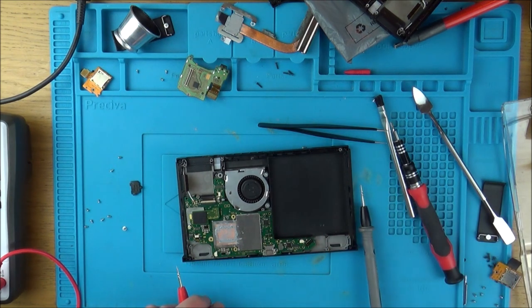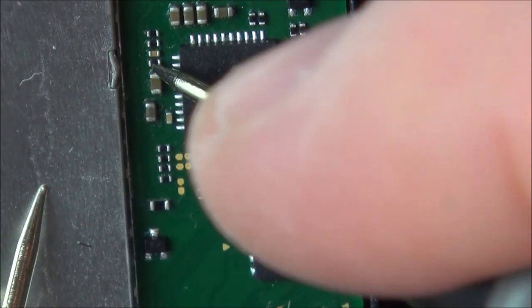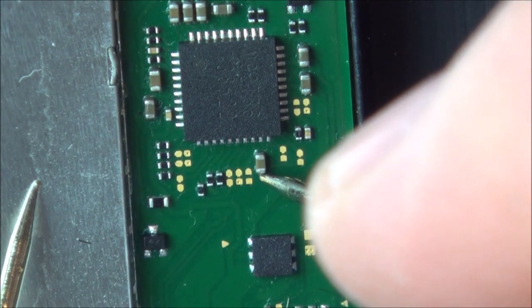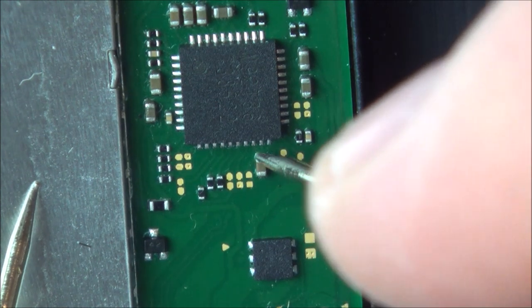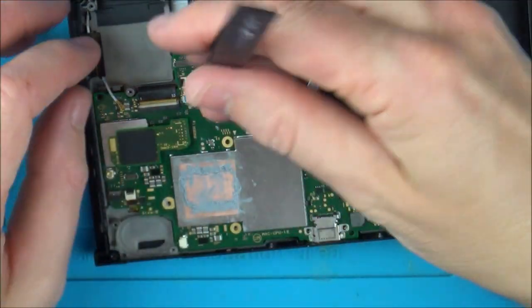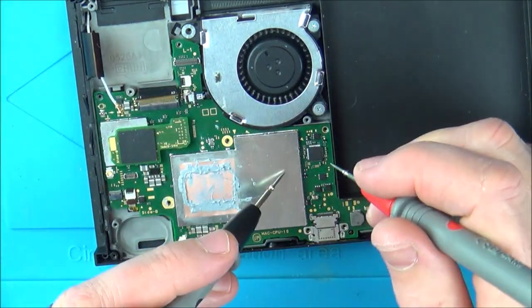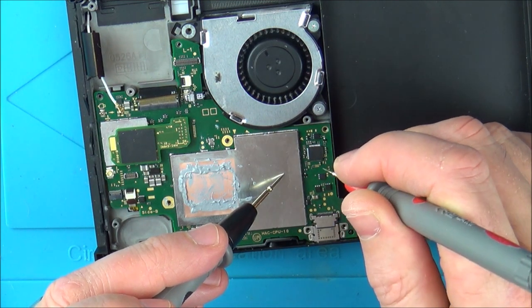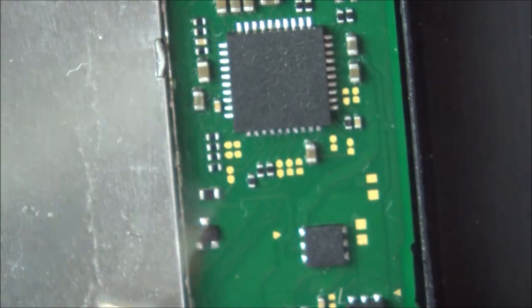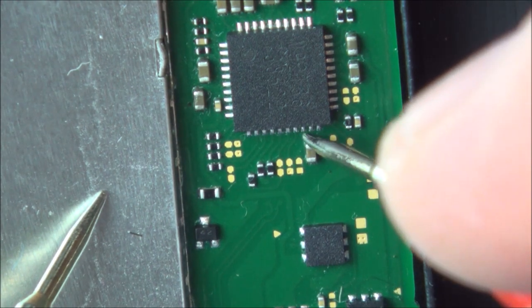It's been about an hour. Here we have the little charge chip just below the fan, to the right of the main chips. If you look at this capacitor — the rest are showing okay, but look at this one: short there, short there, and short there. Now I'm going to zoom out, unplug that ribbon cable, and see if that short stays or goes. The screen's been disconnected — and there you go, it's just underneath now. So when we put the ribbon cable in, it's putting a short on the side that goes to the chip.